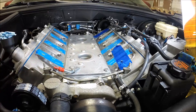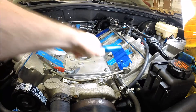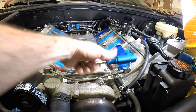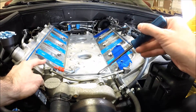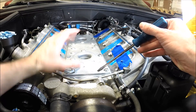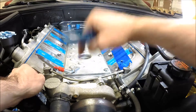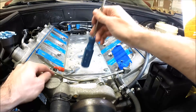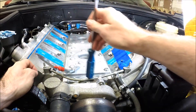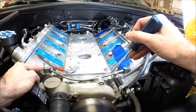I just don't like the pinhead bolts that come with the Dorman intake. Now let's talk about the steam vent lines. If you have any motor that has the LS6 intake on it from the factory, you only had a front steam vent line. That will have some clearance issues with the intake manifold, particularly because you've got this great big 90mm snout on the front of it, and that takes up more real estate than the 75mm snout took up. You have to hammer this downward just a little bit — it sat up just a little bit higher. I took a wrench and a little mallet and just tapped this down just a little bit. You don't want to crack the line or damage how it fits into the fitting blocks, but you will need some clearance up here.